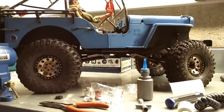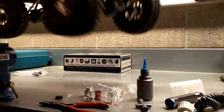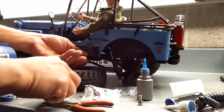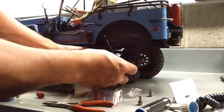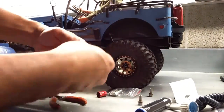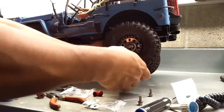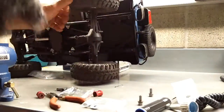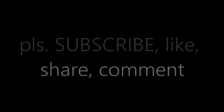I tighten it down a little bit more for good measure so it doesn't back out, then roll the tires to check — looks great. Then I do the exact same thing on the reverse side. I still need that 8mm hub adapter spacer for these wheels, but I have to drill it out slightly because the nut that comes with it is a little bigger in diameter and won't fit. As always, thanks for watching and please subscribe — appreciate it!